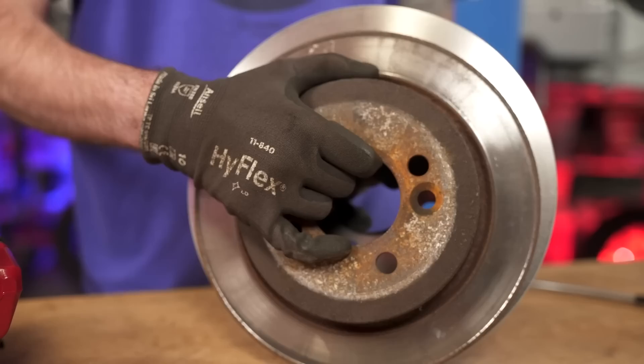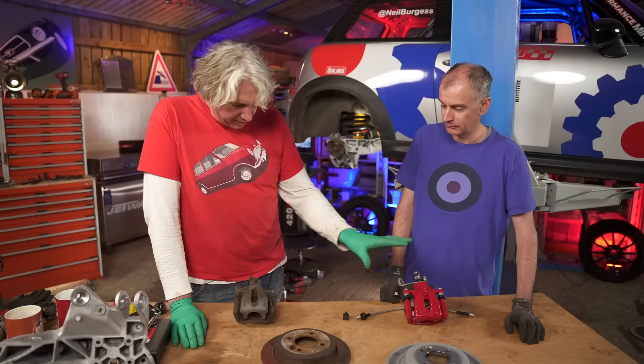So that means you've got a bit more grip or torque, effectively, to slow the thing down. We've got bigger discs now — because you're further away from the center, which gives you more torque. So you're going to have slightly better braking on the back, but how's that going to affect the handling? I've already upgraded the brakes on the front, so more braking on the back would be great. But also the ABS system does more than just ABS — it alters the brake balance. And rear brakes really help even on a front-wheel drive car; they make the braking much flatter than if you've just got all the power going to the front.